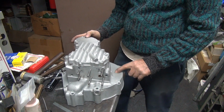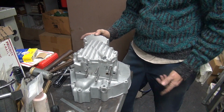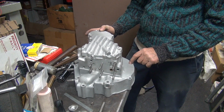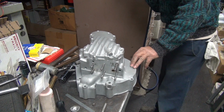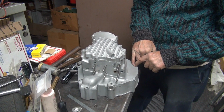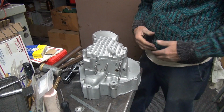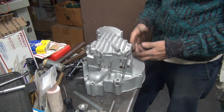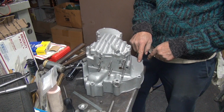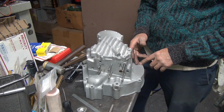See how the repair all pretty much disappeared. You can still see the pinholes from the corrosion. When you weld aluminum, you always have an outer layer. You've got the scale on aluminum basically. The outer layer is kind of corroded from the atmosphere, which keeps it from corroding heavily. But when you try to weld it, it pushes all that out, contaminates the weld, and you get these little holes. So it's hard to get a clean weld all the way across, especially on really old aluminum because there's a heavy layer of buildup.